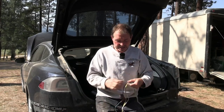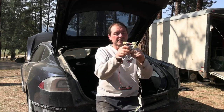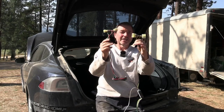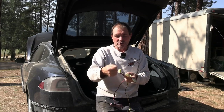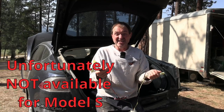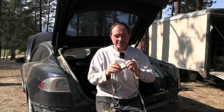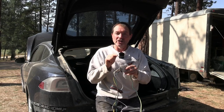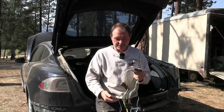Okay, and then we need the signals going in, and those are these plugs here, and hence the name T1 connector, they look like T's. They just T into the harness usually. So unplug the taillight, plug it in, plug the harness back in here. You're done. You just route the wires. The box usually has some sticky something on it, or some boxes have a little ear on it to put a screw in, whatever. And it goes really quick like that.